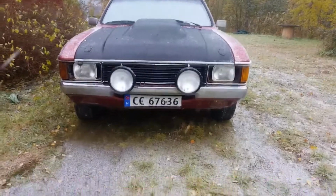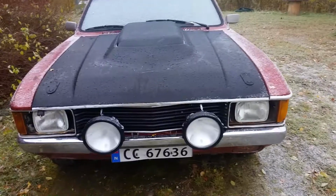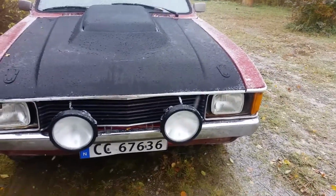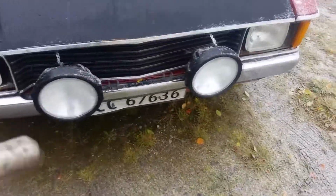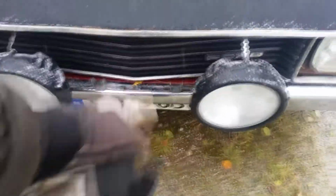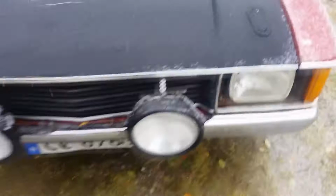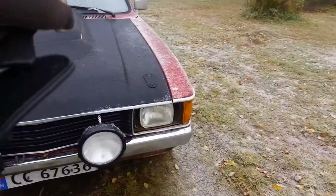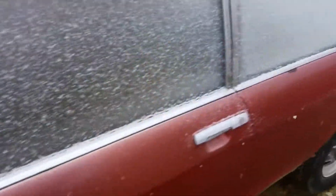But I needed a couple of lights that would light up a little bit further than those 7-inch square things will. So I bolted them up to the bumper. They are on brackets. There already were brackets, actually. You can see these 2 here. Those were in the bumper, and there were already 2 brackets pointing straight out like these 2, as well as an extra couple of holes on either side. There's also a relay in there, a New Era light relay that has been on this thing forever. I don't know when it got there. It was there when I got this car.